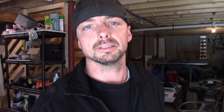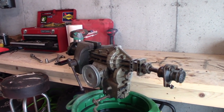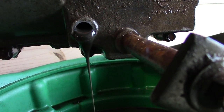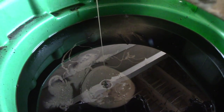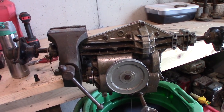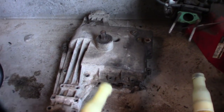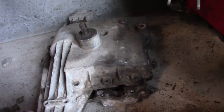The poor Murray has had its transmission removed. Right now I've got it bench-vised in there loosely so I can keep it tipped up to drain this disgusting, sorry excuse for oil. You can see how nasty it is — it's grayish, which tells me somehow water got into this case. Whether or not that is the reason for failure I do not know. For those wondering, this is a Tecumseh Peerless MST-205. Some of you probably remember in one of my past videos I had a Peerless 820 that was given to me, and you can see it's still really gummy in the case.